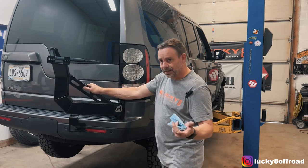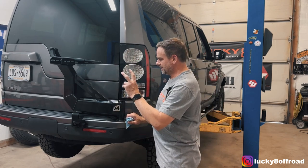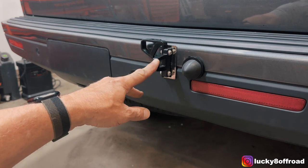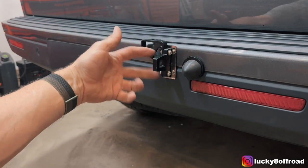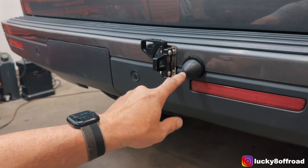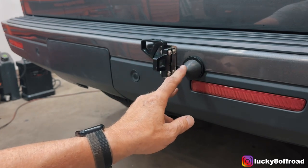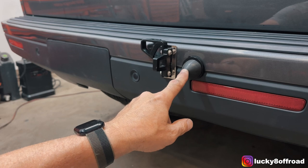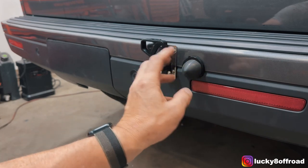That's been done — it's a little bit tight under there, you may want to loosen the bumper cover up. Next on our list is the latch and it's got a lot of bolts — you're going to love it. Here we are at what I'm referring to as the contraption portion. The strut bolts to the driver side — it goes with these two little allens and the nuts, that's going to be our strut bracket. The rubber bumper has a threaded hole that it goes into. The template did not work for me — knowing this, I would have put a bolt in there, put the bumper cover on, kind of banged it a little bit with a mallet to mark where the bolt was, and then drilled there. My hole was about here so we moved it over — no big deal, the bumper covers up a lot of that.